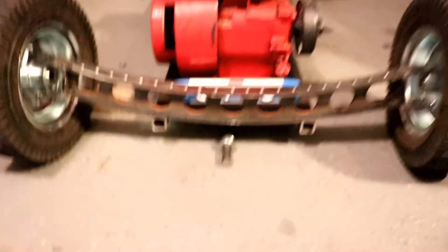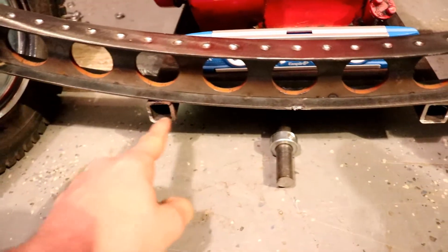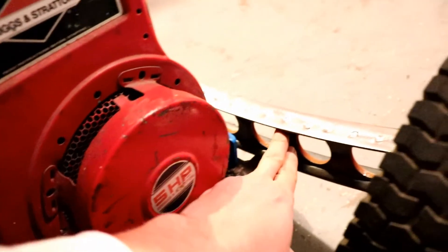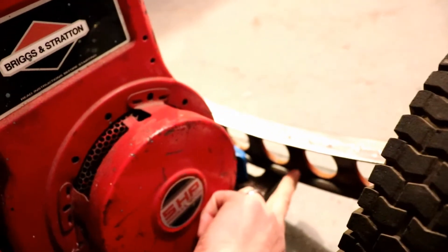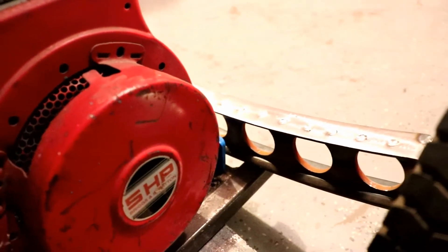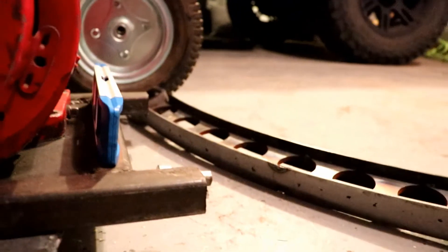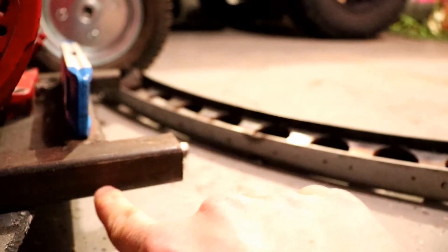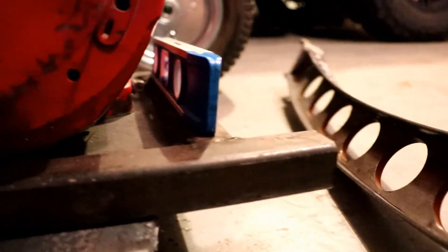So we do that — let's try to get this kind of back on there. Yeah, it's fairly well centered. You see the holes — I think I'm going to wind up either fabricating a kind of triangular piece that's flat stock to fill this gap and get material in between the holes, or I'm going to taper off the frame down here at the bottom, kind of boat-tail it up, and just have it die into somewhere in there.